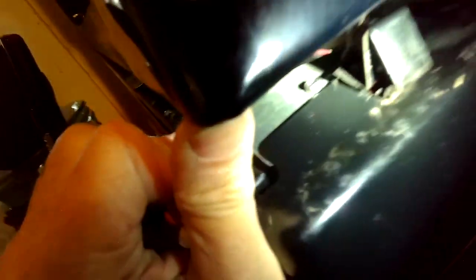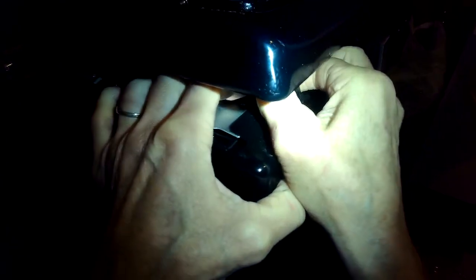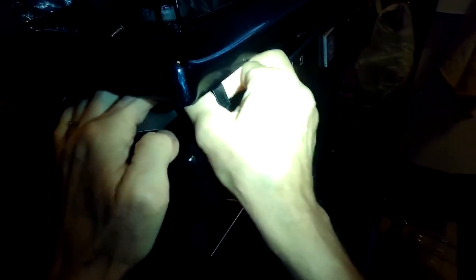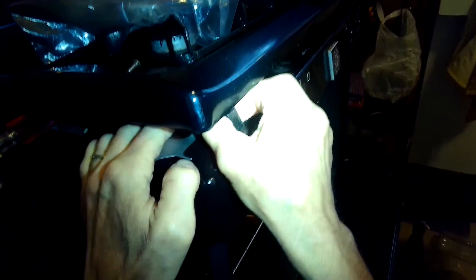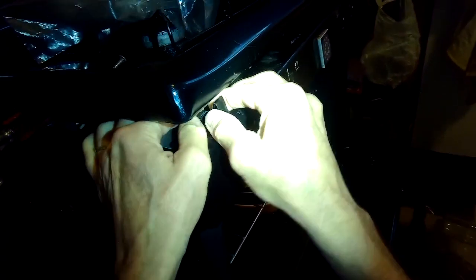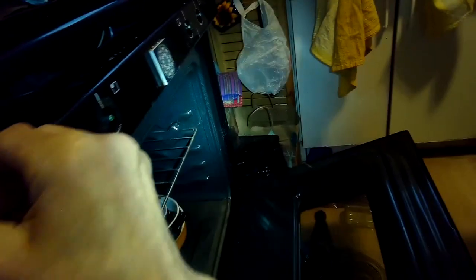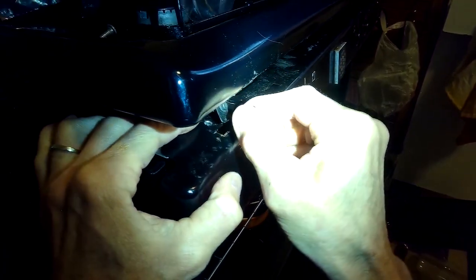You just want to come up a little bit — you don't need much access, just enough to fit your hand in there. Make sure it's unplugged and put a screwdriver in there to hold it up, then loosen this one screw. This one is finger tight so I'm just using my fingers. It's holding on this little spring clip, but you'll probably need a quarter-inch socket — just a shallow one so it's easy to get in there — or a pair of pliers would do it too.